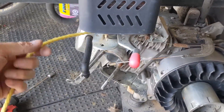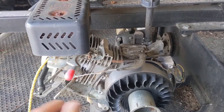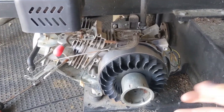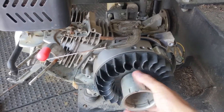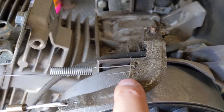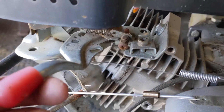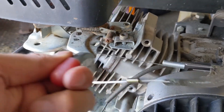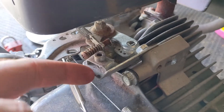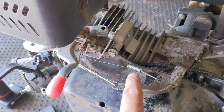Once you have that torqued, you might notice you can't get the rope out. All you have to do is spin the flywheel the opposite direction so the piston lowers a little bit, and then you'll be able to fish out all of your rope — and then that spins around nice and free. The new throttle linkage and spring is hooked up, and the new governor spring is hooked up from the middle hole down to that tab. Not the upper hole, because I noticed when I moved it back the spring fell out — the customer probably hooked it up to that hole thinking that's where it went. With this bent the proper way now, I'll still have to set the RPM, but at least things work the way they should.